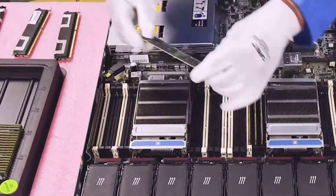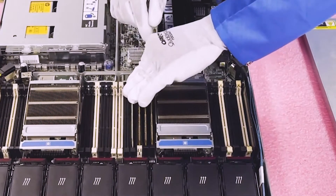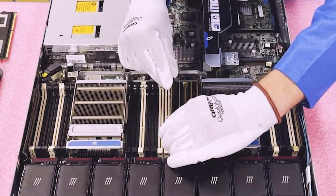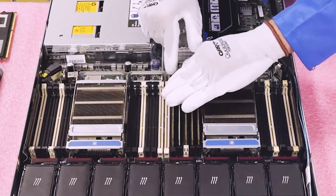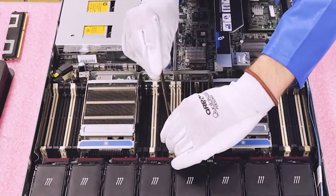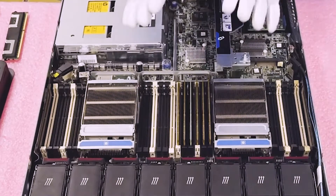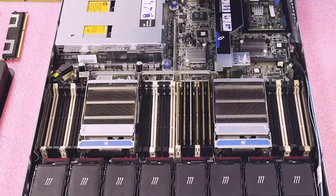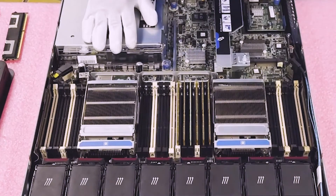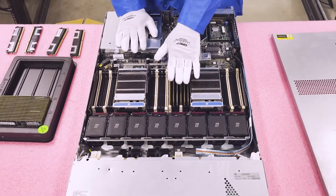We've just done a quick six modules to demonstrate. I personally believe that when you're working with a machine like the DL360P Gen 8, since newer Gen 10 servers start at $10,000 or more, upgrading or using a refurbished machine is smart. The best way to extend the life of your machine a few more years before moving to a Gen 9 or Gen 10 is a memory upgrade — upgrading RAM is where you'll really get the biggest boost in performance compared to a CPU upgrade.